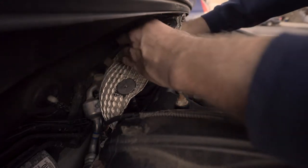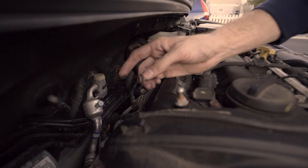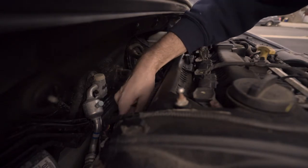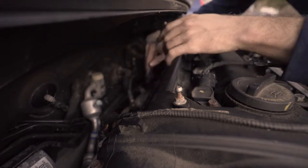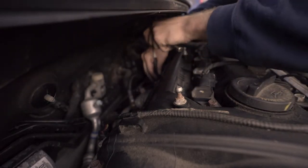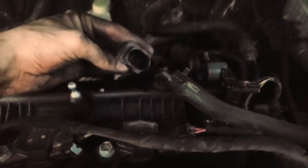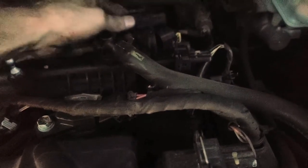Slip the O2 sensor plug into the hole and ensure that the wire is on these clips and out of the way. Take the bolts you removed previously and reinstall — I like doing the back one first as it's harder to get to. If you have trouble getting the third one on, loosen one or two of the other ones up. One important thing I almost forgot: plug your O2 sensor back in — exact opposite procedure of what you did before.